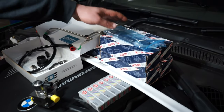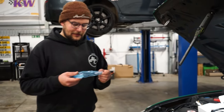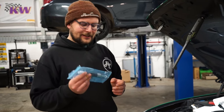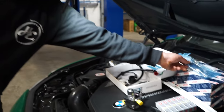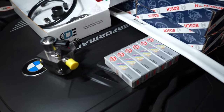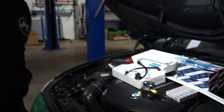We've also got the latest part number Bosch injectors. We've seen a few cars with injector problems - I don't think it's quite as common as the internet might have you believe, but it's not worth risking, especially when we're asking more and more of them. We've also seen these later part numbers seem to get a little bit more power, whether just a slightly better spray pattern or flow. And then the final thing is just spark plugs while we're in there.